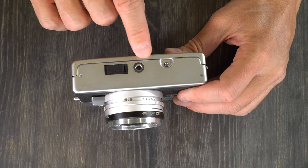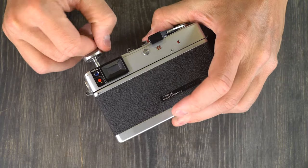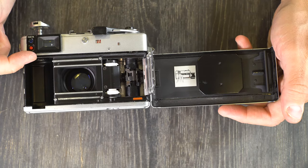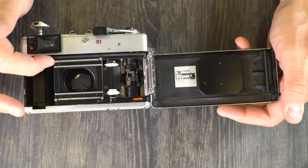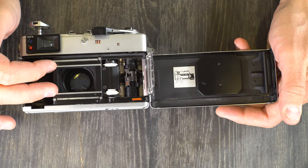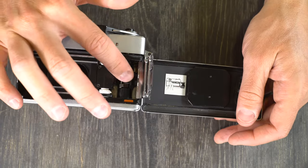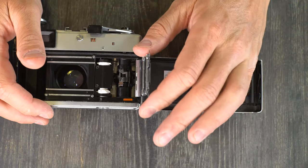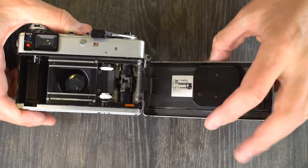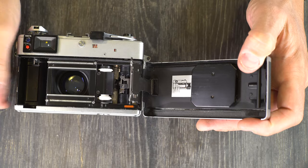On the camera's bottom, we have the battery chamber, tripod socket, and film rewind button. On the inside, we have the quick load system, which is very nice — a great innovation. Film cassette chamber. Film guide pins. Guide rails are these four silver things — the ones on the outside keep the film from moving up and down as it travels, the ones in the middle work with the film. Film pressure plate to keep the film flat on plane. Film take-up sprocket. Tension sprocket. Film take-up spool. The two rollers on the quick load system put tension on the film when loaded to keep it on the sprocket. Film cassette spring to keep the cassette oriented properly within the camera.